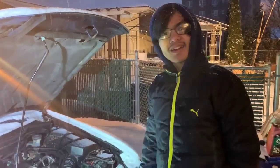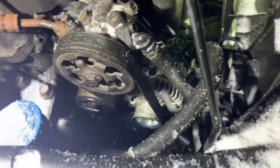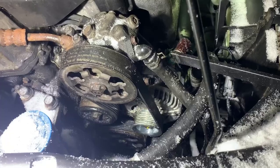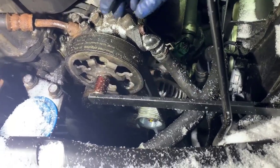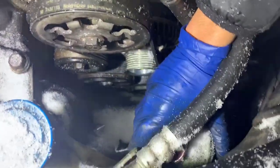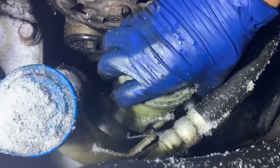Now all that's left — alright, so we have the belt. All I have to do is pull the tensioner back and then adjust it. Word to the wise: when you're doing this, don't completely remove the serpentine belt because you're going to have to put everything back on again. Instead, just tuck it off to the side. Also, the last thing we should do is take this tank and slide it into its notch.